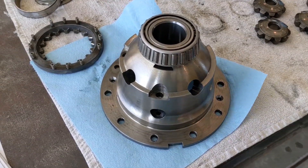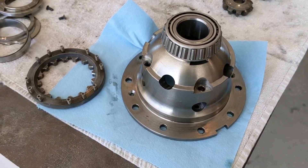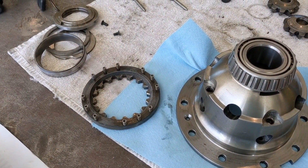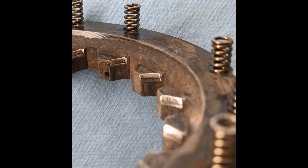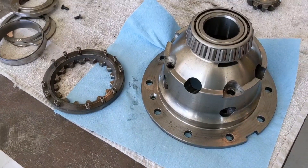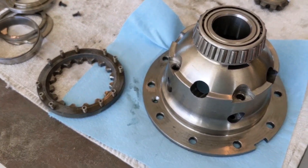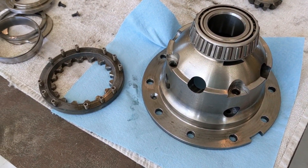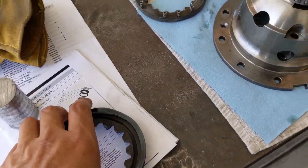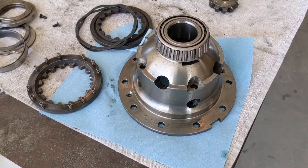Back to the update: I spoke with the ARB rep who reviewed the pictures I sent, and he confirmed that my clutch gear is toast. He said normally when these things get destroyed it's because people are trying to engage the locker while their tires are spinning, and it just breaks them. I described my problem and he said the story matched up with what would be considered a compressor problem. In the mail today I received a new clutch gear and wave spring, so I'm going to go ahead and put the ARB back together now and then investigate that compressor.